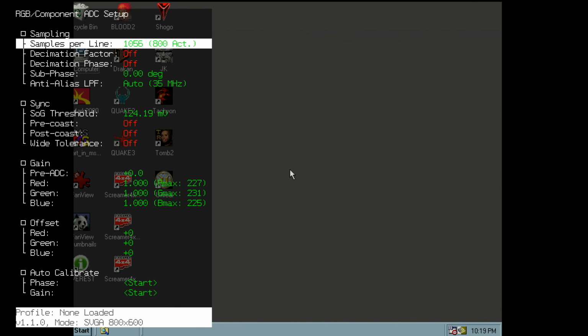We can stay at the desktop. There are 3 buttons on the remote control that we need to press. Auto phase is the first one that adjusts the phase to the signal. If the samples per line is not correct, then the auto phase will be hit and miss and it will not work correctly. The next thing we need to do is get the cropping right.